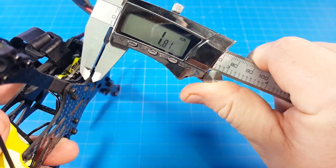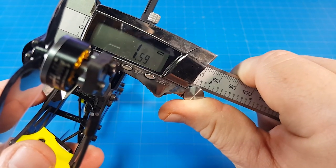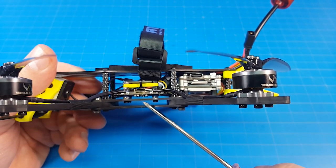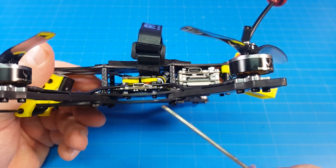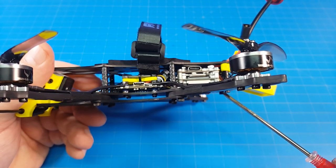The arms look like they're 3.5 millimeters thick. The sandwich plates look like they're at least 1.5 millimeters thick. The top plate is also 1.5 millimeters. Technically these aren't a sandwich plate — it's more of a split plate, as the bottom piece runs clear to the front and then this secondary piece up here runs clear to the back.